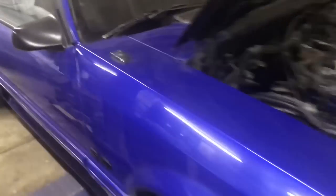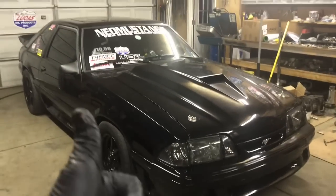One more thing in closing, and we'll probably do this in another video: you're going to want to roll the lips of your rear fenders. I did this because I race a lot so my slick wouldn't catch. On a normal Fox Body you can see the fender lip — it sits up like a lip and it will cut your tire. In an upcoming video I'm going to show you about cutting springs and doing that Eastwood fender lip roll. Thanks for your time — make sure you hit the like and subscribe if you watched this far, and hope to see you guys out at the strip.